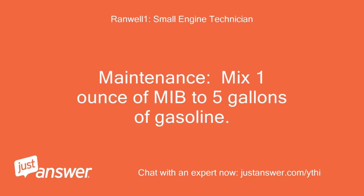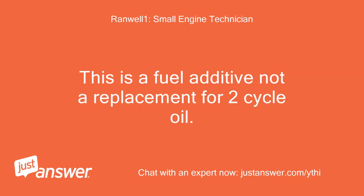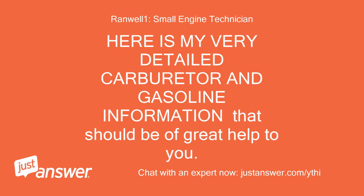Maintenance: mix 1 ounce of MIB to 5 gallons of gasoline. I recommend using at least 2 to 3 ounces. This is a fuel additive, not a replacement for 2-cycle oil. This helps sometimes, but other times it does not, and the only solution is to clean and rebuild the carburetor, or replace the carburetor with a new one. Here is my very detailed carburetor and gasoline information that should be of great help to you.